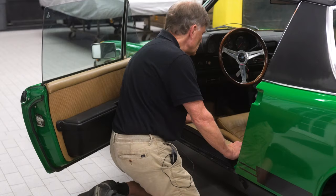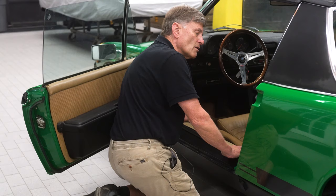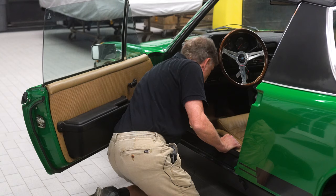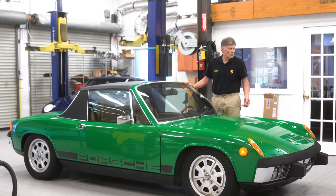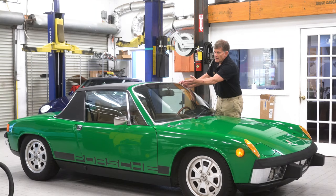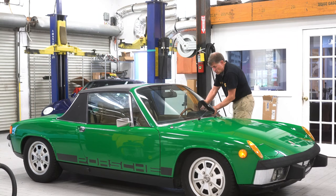Almost ready to drive. I'm going to look at the clutch pedal because too many people leave the cable out of adjustment, which grinds out first gear. First gear should be totally slick and you should be able to go into first before coming to a complete stop. The pedal should be all the way up at the top. If you can grab the pedal and pull it up, the clutch is out of adjustment. Wiggle it to make sure it has some free play — this pedal is in perfect adjustment. Also, check the interior rear view mirror — it should be four inches down from the chrome so you can see behind you. This car has an optional factory mirror on the right side for good visibility, though the mirrors are a little hard to adjust.